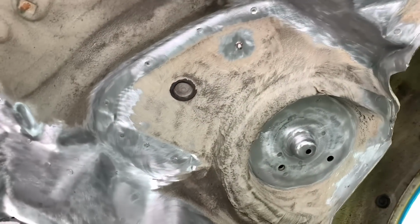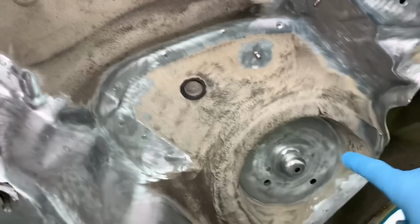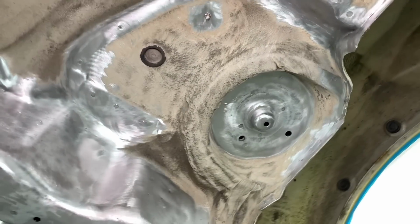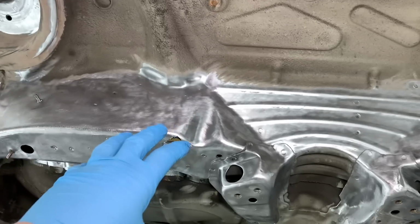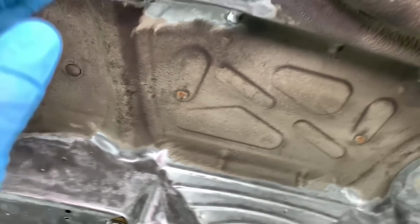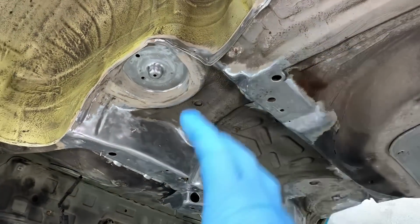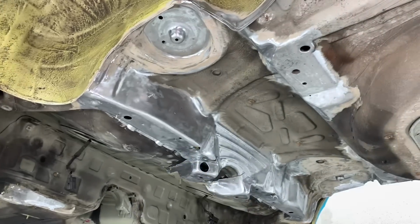Taking off corrosion on the other parts of the RACP as well, on the roof section. That's the rib panel up there. Then we've got the spring perch, which is suffering with corrosion. And on the left-hand side as well, just taking out all of those areas that are nothing to do with the RACP repair and reinforcement process, but we tend to do them because, as you've seen on our videos over the years, we don't just paint the localized mounts, we go through the car in a great way.